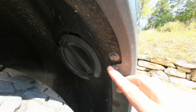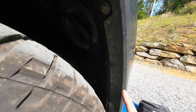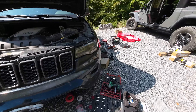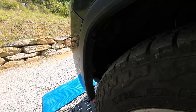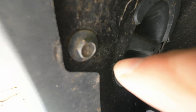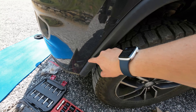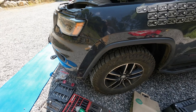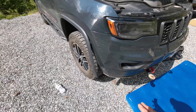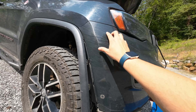We've got the bull bar and light bar off. Next we're taking the whole front bumper off. There are a couple of clips up here that need to come out, some along the side in the fender well, a bolt here, and some push pins. I've had this off several times, so I've replaced some plastic rivets — if you're doing this for the first time your fasteners might look a little different. Working your way down, this trim kind of gently pops out.